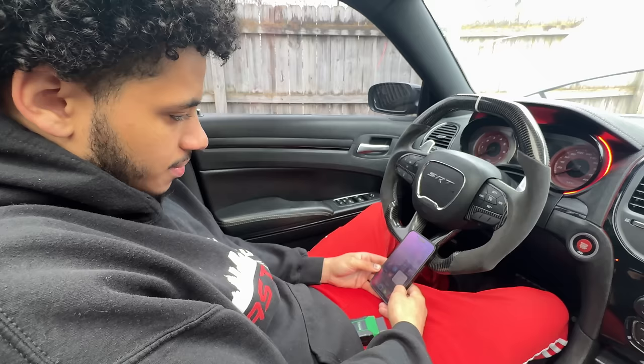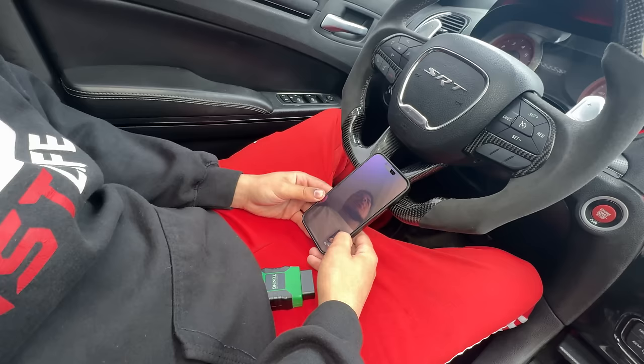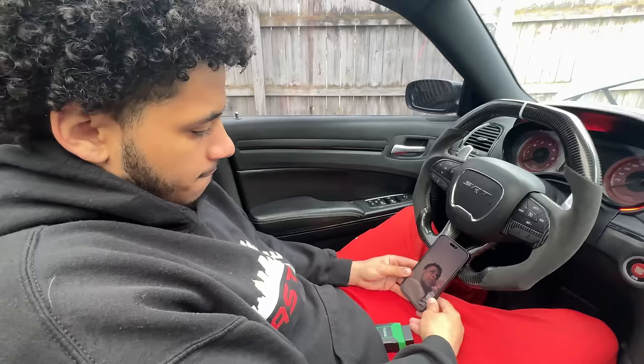All right, so when you go to TDM, you click data log down here. Yep. When your stuff is plugged in, you're going to click start. You're going to click OK. Give it about 15 seconds, and you'll see like RPM and stuff, and it'll start data logging. And then just drive around in it. You can floor it, too, if you want. So, basically, drive it regular, do my regular driving, pulls, and all that extra stuff. Do it for like 3 or 4 minutes, and then hit stop. And then it's going to try to end the log. And after it's done, you want to click view and sync files, then click upload, and then click sync files.